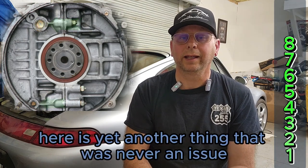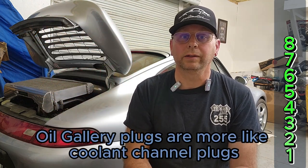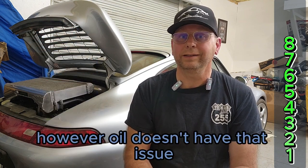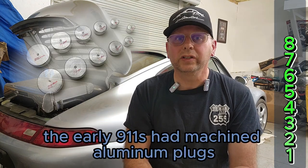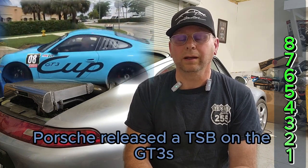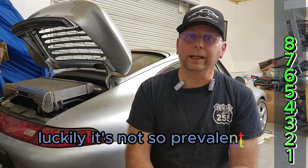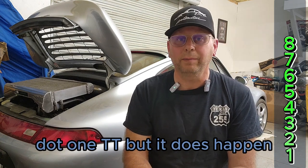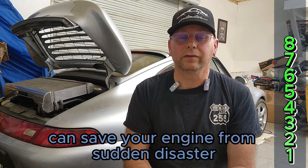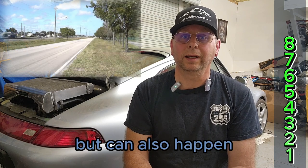Oil gallery plugs. Here's yet another thing that was never an issue till they changed it. The new improved oil gallery plugs are more like coolant channel plugs you'd see on a Chevy V8, designed to blow out in cold weather to save the block from cracking under extreme pressures from ice. However, oil doesn't have that issue, so why are they there? The early 911s had machined aluminum plugs pressed fit into the plates; the newer engines get these formed steel caps knocked in place. Porsche released a TSB after plugs were blowing out, pumping all the oil out of the engines and ruining them. Following the TSB and peening the plug in place along with epoxying over them can save your engine. This is most prone to happen on extreme cold starts where pressure is very high, but can also happen at high speed.